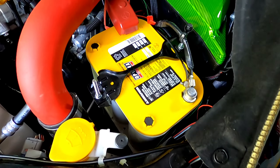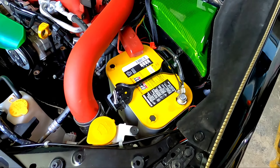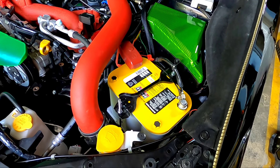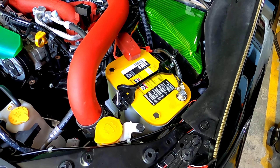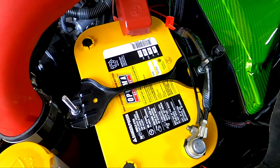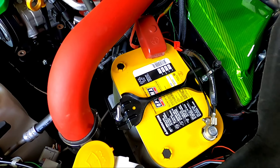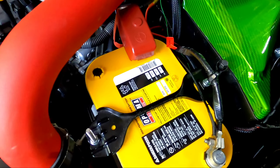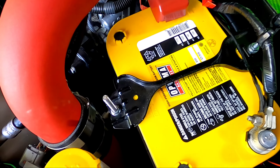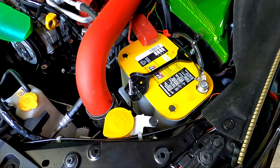Finished product — about to start the car. After taking out the old battery and putting in the new one, you'll need to adjust your settings and clocks, and take the car for a run so systems like an Accessport can relearn. Also, that Subaru battery tie-down is pretty bad — drop a comment if you know of an aftermarket mount I should look into.